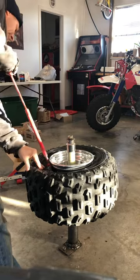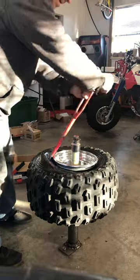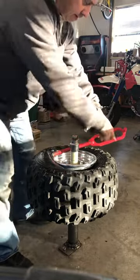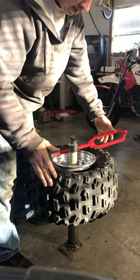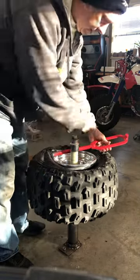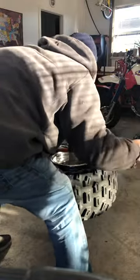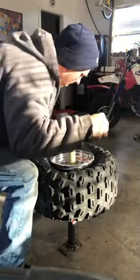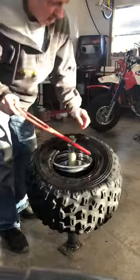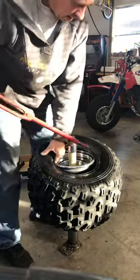So you want to get this in here, around like that. What I like to do is go clockwise, that way any of my bolts holding this rim — one here — are trying to tighten as I'm doing this. Going the other way you could end up loosening everything. You just work this thing around.